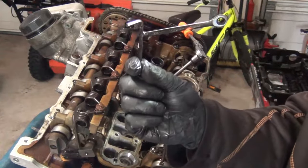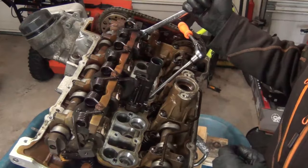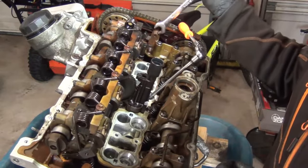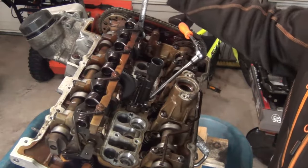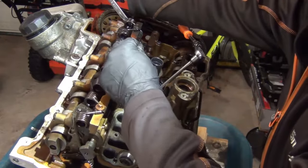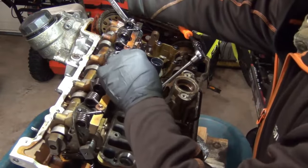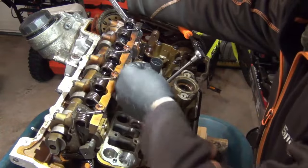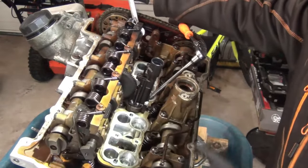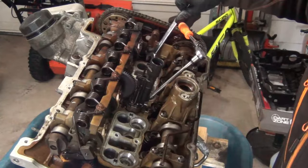The next step is to use a 4-millimeter Allen — we need to go to maximum stroke. I'm going to use my spanner wrench, which was a 14-millimeter, on the opposite side, and go to maximum stroke. I'll put the Allen down into the slot where there's a 4-millimeter Allen screw, and put it where it's going to stop itself on the motor. That's my holding point because I have to remove the stop, which is right over here.